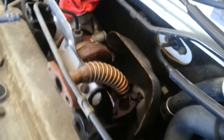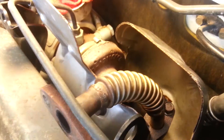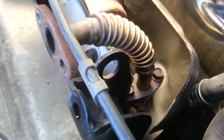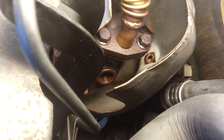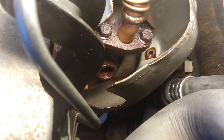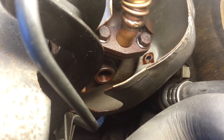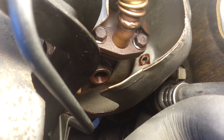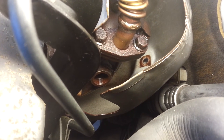P.S. I forgot — I did take off the rear shield as well. I didn't actually remove it, I just unbolted the three bolts for it, and that allowed me to get to the rear O2 sensor, which is bunged right there. This O2 sensor was very loose, so there was a leak here — I'm not surprised the car didn't run very well. So that's the second leak I've found taking this car apart. These 60,000-mile services help you catch things that you normally wouldn't touch because you think everything's fine.